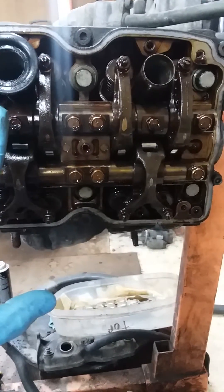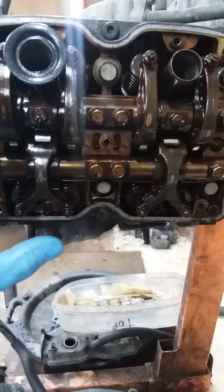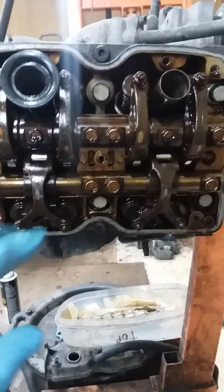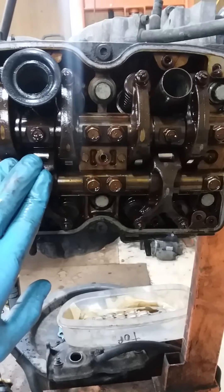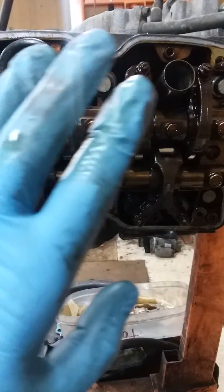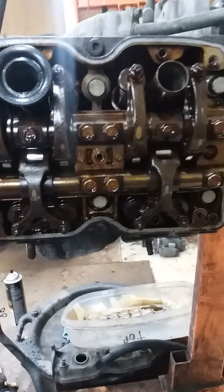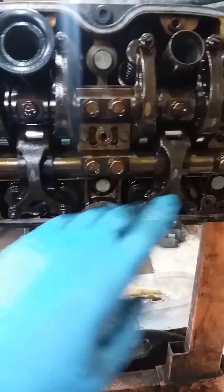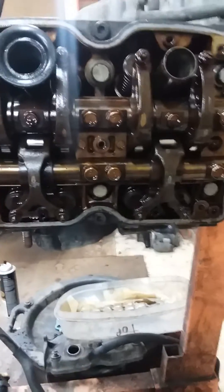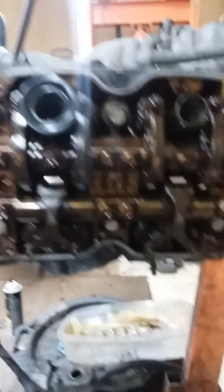That is your torque specs. 75 all the way around in 10-pound increments, starting from 35 after snug — not hand tight, not break-the-bolt tight, just snug. Snug them all, go to 35, then 45, 55, 65, 75 — stop at 75. Do the sequence every time, jump from side to side, keep increasing your torque wrench a little bit each time. After you have 75 all the way around, go to 85 on the center bolts. I go ahead and do 75 again then do 85 one more time just to make sure. Ain't never had any problems with this. Hope y'all enjoyed the crappy video.